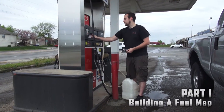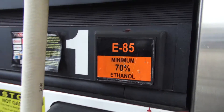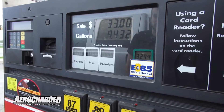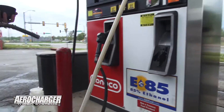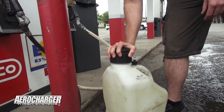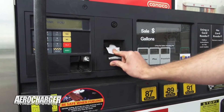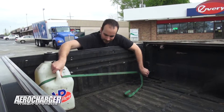We just filled up with E85 — it's 85% ethanol and 15% gasoline, coming out to typically around 105 octane. You do have to watch it during the summer and winter though. During the summer it's a higher octane fuel, best for turbocharged applications. You can buy the summer blend from various companies all year long, but during the winter it will be a little harder to start, which is why fuel companies actually change the blend.